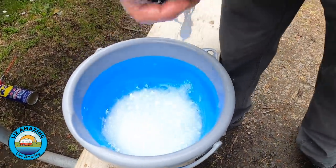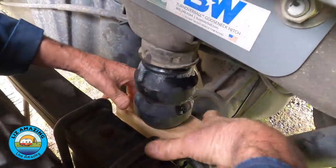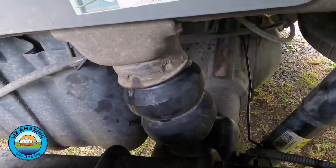If you can change a tire, that's about the level of expertise you need to install the Timbrens. I've done it on two different manufacturers' trucks — a Ford and a Chevy. The Ford was easier, only needing a ratchet and a socket. The Chevy needs a jack, a couple blocks of wood, and some soapy water. On forums, there are people known as the tow police who have strong opinions and will convince you that you're going to kill everyone on the road if you tow a trailer close to the limit. We're not recommending you go over the limit, but if you're right at it and within the guidelines, you can tow safer and with more stability with Timbrens.